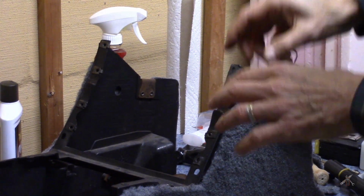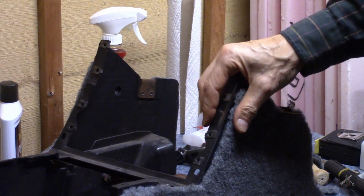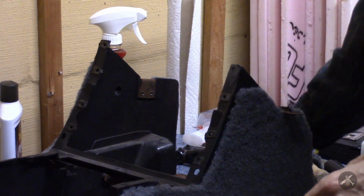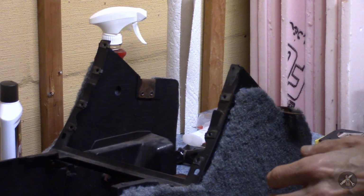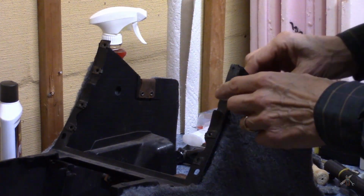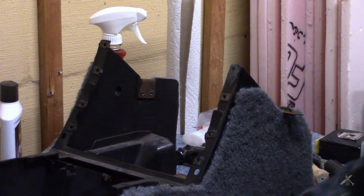But you've got to really be careful because these parts are generally supposed to be flat black, and so the more polishing you do on them, if you use 3000 grit, it'll get really flat and it'll have some fine scratches in it. And if you polish it, it'll be glossy. So it's kind of hard to hit, I'll call it a happy medium.